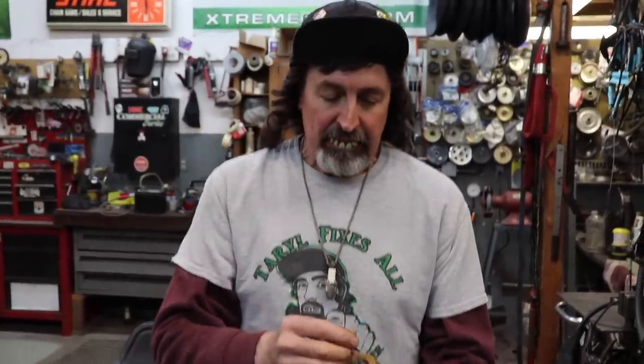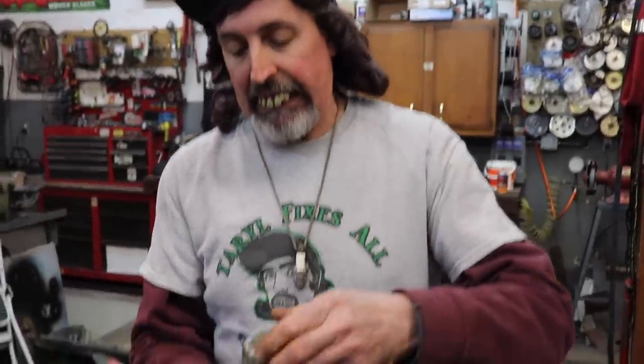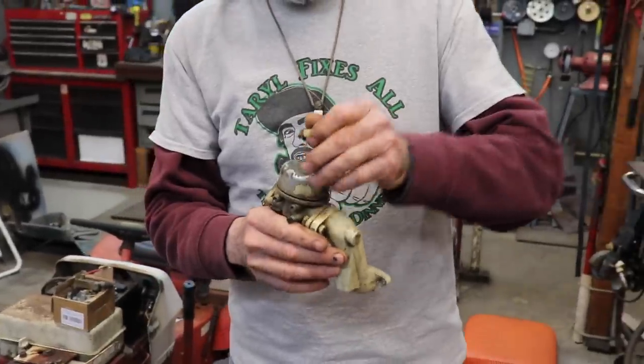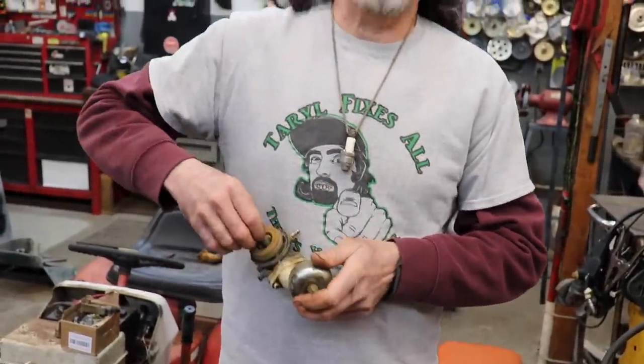They had a service nozzle. So I had to do something with the lining up or alignment of these holes in the nozzle. And of course, if you've done that, and you can't get the carburetor to work right after that, and you can't get that service nozzle because they probably don't make it anymore and you can't find it, the carburetor is basically junk.